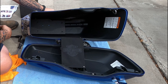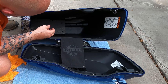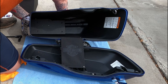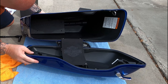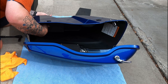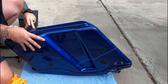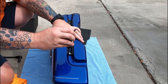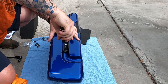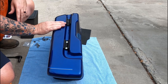We've got that lined up with the holes, and we've got our custom rubber piece here that replaces your factory one. We come up from the bottom and these do take the T15. I'm going to lose the angle here because I have to get it flat so I can get these started. Both are started in there so now I can close it. Just tightening them down — I don't want to tighten them down too much because it's just a rubber insert and it'll push right through it.